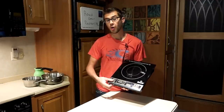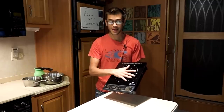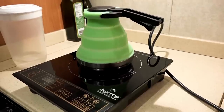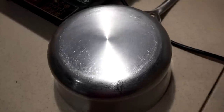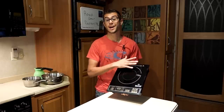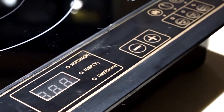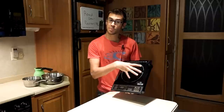This unit has automatic pan detection — when you turn it on it will beep until you put something on it and it won't turn on at all until you place an induction-compatible pan on it. This requires induction-compatible cookware, meaning it needs to have a ferrous base. Stainless steel cookware inherently won't work, but many brands now put a magnetic bottom in them. Aluminum won't work at all. The top portion where the pan sits is a nice thick glass with rings indicating where your pot should be set, and it's designed to adjust power to the right size pot.